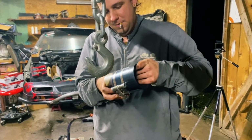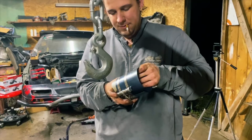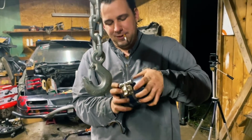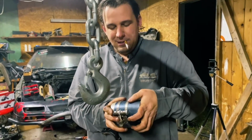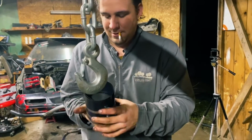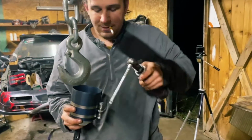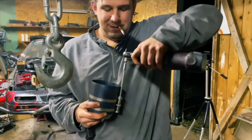Just kind of, the rings kind of twist and then line up. Because they will twist naturally in the engine, whether you like it or not. But generally, they should never line up. That's the hope and dream. In some cases, you're not so lucky with that.